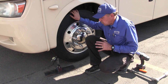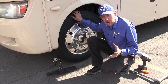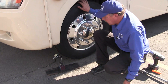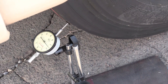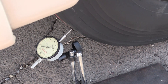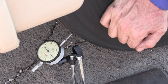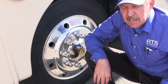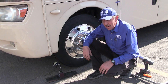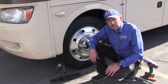We've had the tire replaced, so we have a brand-new tire on this that is round and balanced. Now I want to show you the runout — what you should have on a brand-new or used tire. Before, we had over 100 thousandths of runout; now we don't have that. This tire being round and balanced shouldn't produce a vibration. We can see we have a pretty good, minimal runout on that tire, which is what you're expecting. If you're checking a used tire, you can't have 100 thousandths or you're going to have a vibration. Now let's go drive this car and take it for a test drive.